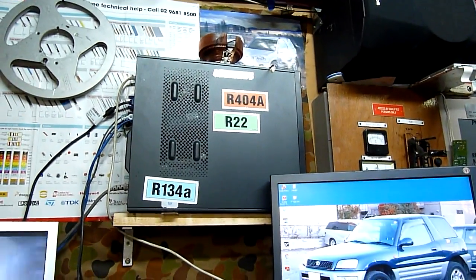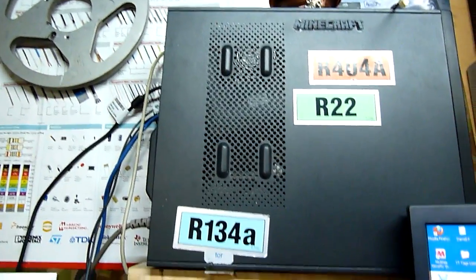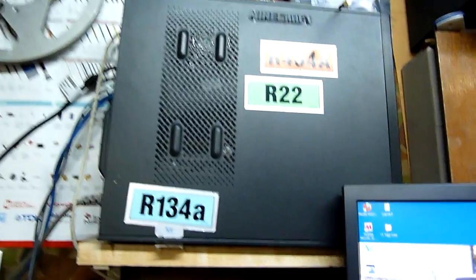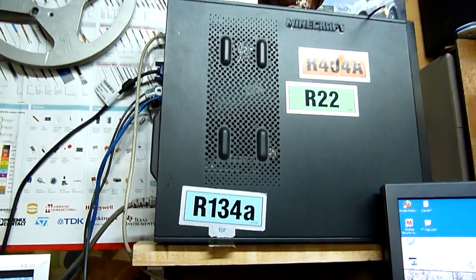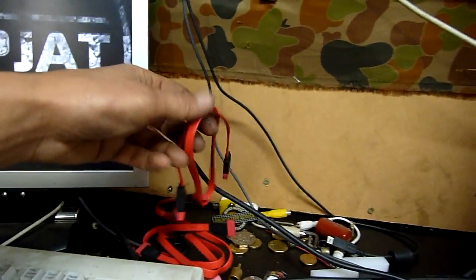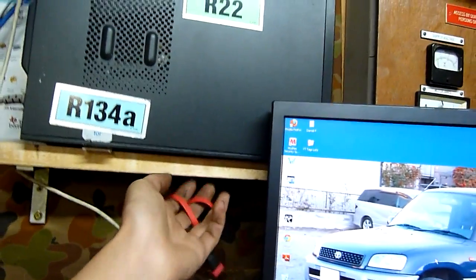I moved the little PC up a little bit, and I'm going to put a little shelf in underneath to put this portable hard drive in there, otherwise it's a bit tricky to set up. I just don't want it on the bench with bits of crap getting cluttered around it. I'm going to make a little modification to this case and fit a small generic PCIe graphics card in there, just so I'm not running off the onboard graphics anymore. It should help with video editing a lot. I've got plenty of spare SATA ribbons so I could probably run an external hard drive out as well — another SATA drive and just screw a carrier to the underside of this and stuff it in there.